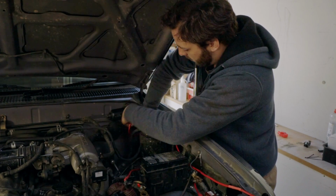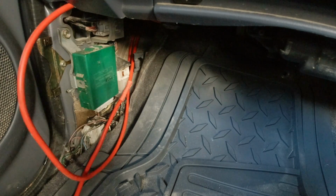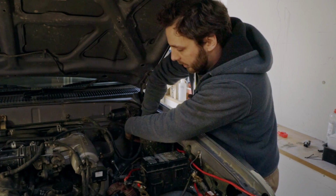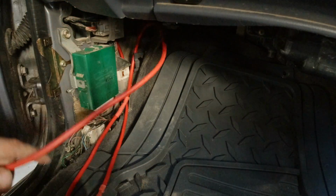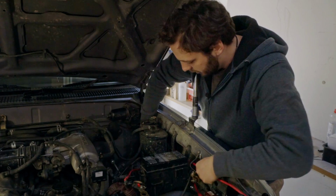As often as possible, you want to be pushing cable, not pulling cable. When you start pulling it, if it gets caught on something, of course, you can start breaking things, tearing things. Pushing it, you'll feel resistance, so we'll go check it out. Sure enough, it was just bunched up, so we can keep feeding the rest of it through now. There we go, sorted.